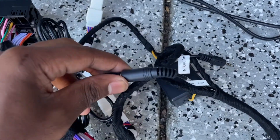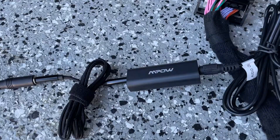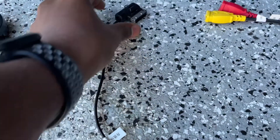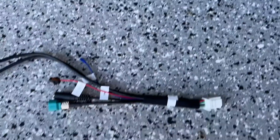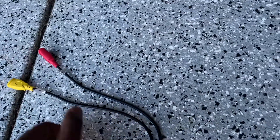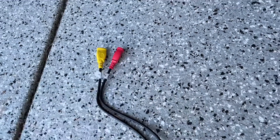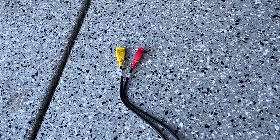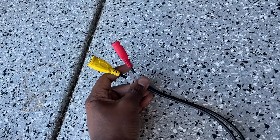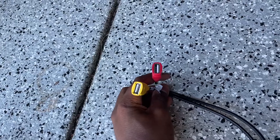This wire here is going to extend all the way down below your center console, reach the center console, plug into your ground loop isolator, which then plugs into the media interface port. Next we've got the USB connection — this connects to USB ports, and I'm going to route these down to the passenger footwell where there's a little cargo net. We can plug in our CarPlay dongles and all that stuff there — you can plug basically whatever you want through USB since it's an Android unit.